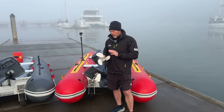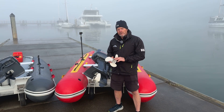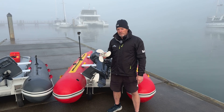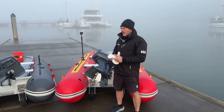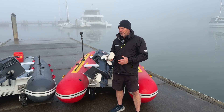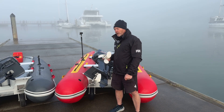Then you've got the material the propeller blades are made out of. These ones here are aluminium, but aftermarket you can often get stainless steel propellers also. One advantage of a stainless propeller is they are stiffer and thinner, so generally a stainless propeller is a higher performance prop than an aluminium one.